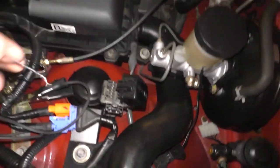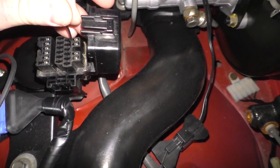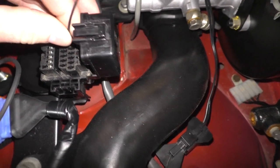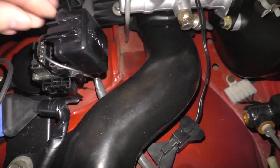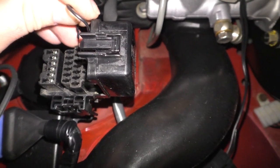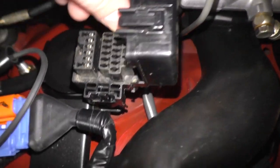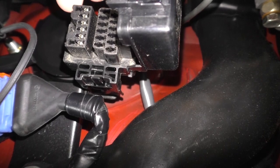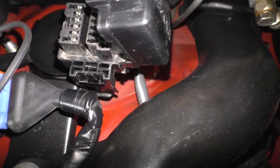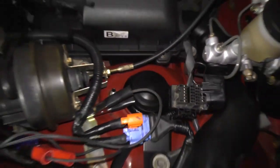And what this is going to do is tell the ECU to cool your jets. I'm adjusting timing. I'm looking at things. I'm adjusting idle speed. Leave me alone. Don't intervene. Just roll with it. And that's what it's for. It just tells the ECU to go into basically diagnostic mode. Well, not entirely, but for the sake of this conversation, that's what we're going to call it.